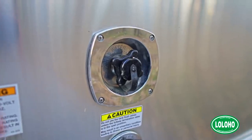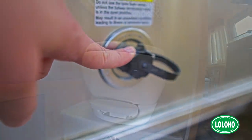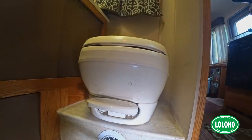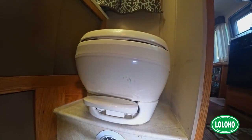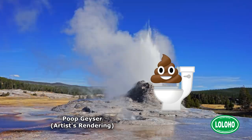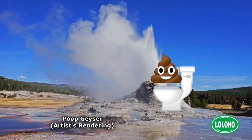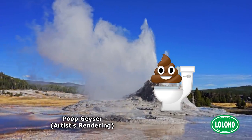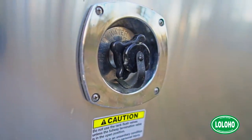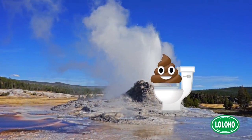But that's not the worst thing that can happen. The worst thing would be the dreaded poop geyser. If you connect city water to your black water tank flush inlet, turn it on, and walk away, water fills inside your black water tank and in a matter of time it fills up. Where does it go? It rises up through the toilet — the dreaded poop geyser — all the contents of your black water tank gushing up from the floor around your toilet, maybe up through the toilet into your RV. You can imagine worst-case scenarios where the entire RV is flooded.